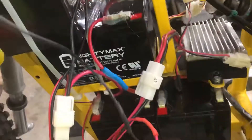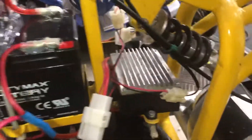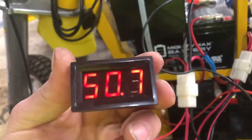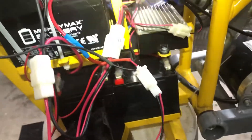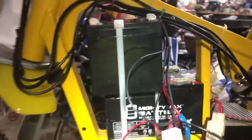That will just charge it — you've got to make sure you get a 48-volt charger, can't use the 36-volt anymore. I also wired in this voltmeter, and that will go in right where I've got the square cut out there in the fairing, so we can keep an eye on the voltage.